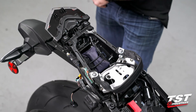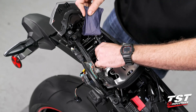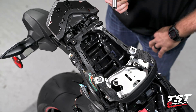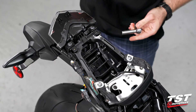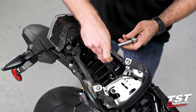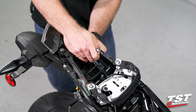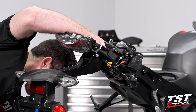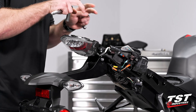We're now going to go ahead and take the toolbox that the manufacturer gives you. Grab a 10 millimeter socket and a 10 millimeter box wrench. We're going to go ahead and take the socket — make sure we're lefty loosey — and break loose these four bolts. They have nuts on the other side, so you're going to take the box wrench, throw it on this side, and then break that nut loose. Take those nuts, keep them in a safe spot. I like to keep the bolts in until we're actually ready to drop the fender off, being that they are still kind of holding it in.